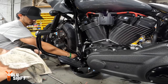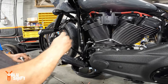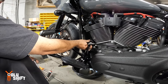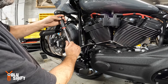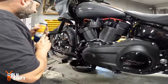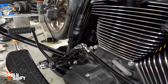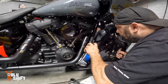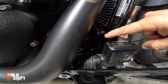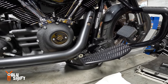Sometimes I can't get my hand in there, so I will put the filter wrench back on there a little bit, but I'll only do it a quarter to a half a turn. But don't forget, you always gotta lube that gasket. I'm gonna hit it from the other side also. Where it mostly gets caught is down in here. As you're riding it'll come back, but you're going to see it, like I said, for a day.